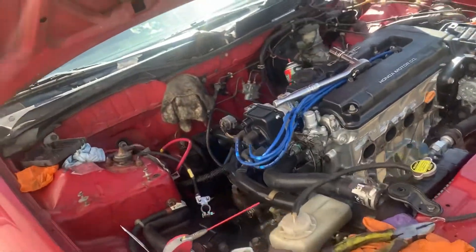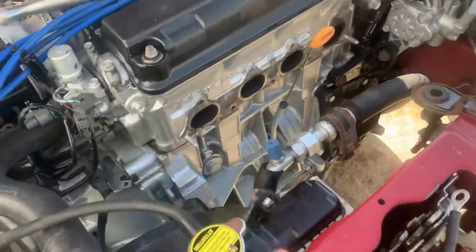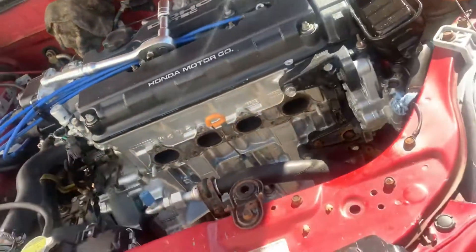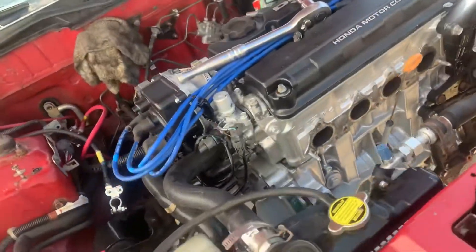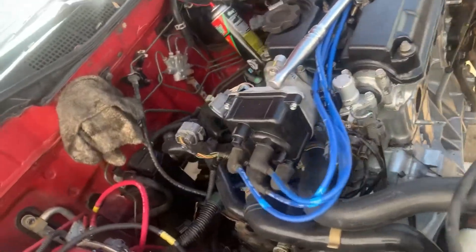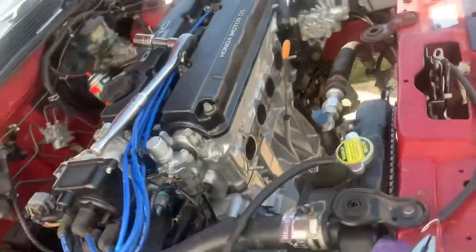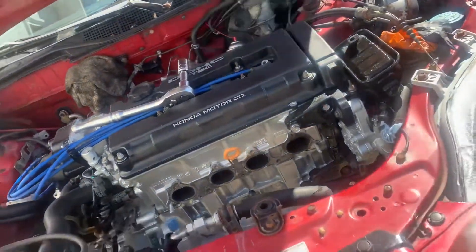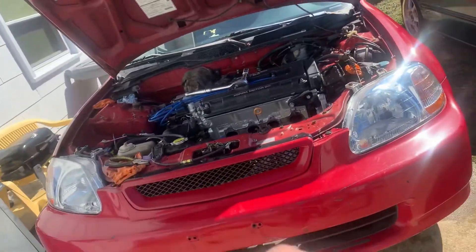Welcome back to the vlog. We're recapping from last night — we found out where the oil was leaking and why it's leaking. If you haven't caught up to speed yet, it's because the previous owner that rebuilt the motor put the head gasket in wrong. What's happening is the oil passage is blocked and it's just forcing oil out in all directions. Today we're going to be removing the head, hoping we don't have to redo timing, and see if we can bypass that.